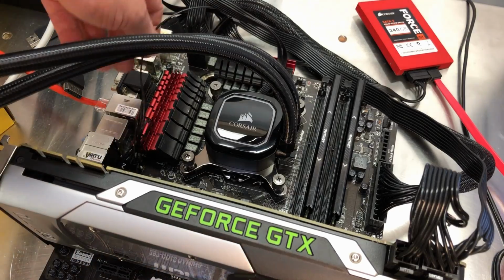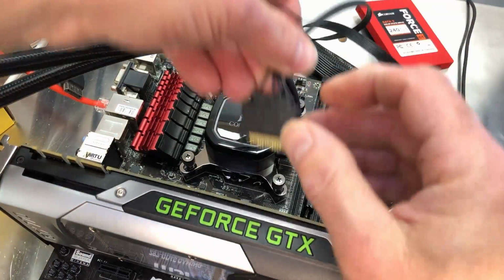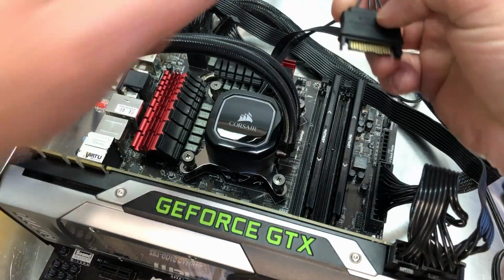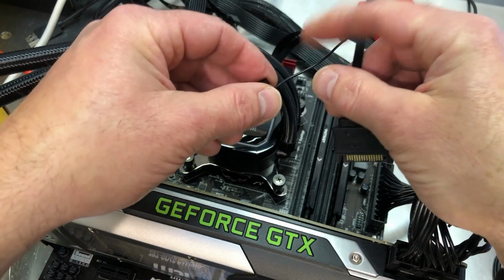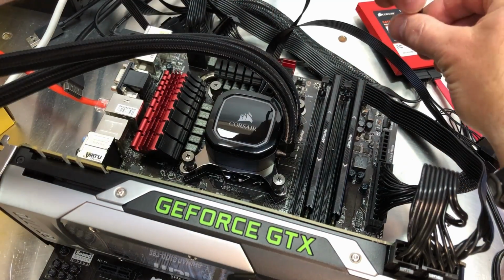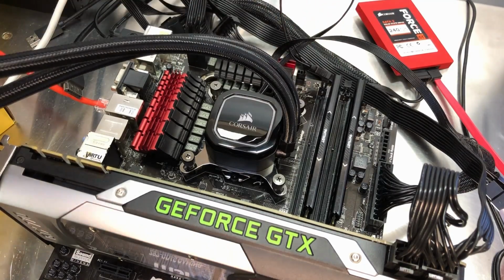All right, now, of course, these are the connections for the fans. And then also coming off of the pump is the power cable for the SATA, and this other lead here, it's a 3-pin plug, but remember earlier, this is just your tachometer basically telling the motherboard that the pump is running so that the CPU does not overheat.